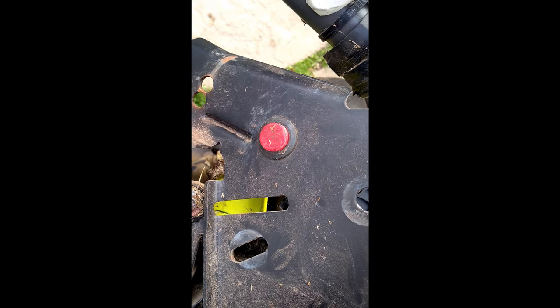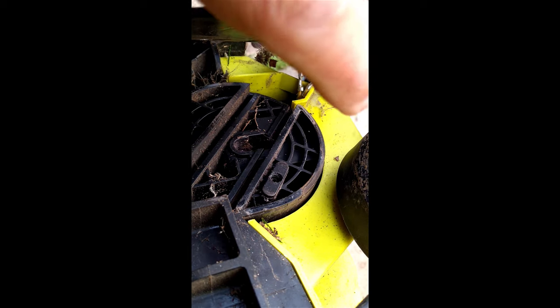When you're done with these videos, if you replace all three the way I show you, your lawnmower will work perfectly. You'll be able to turn it on and off and won't have any issues with it stalling out or dying. Let's get started. Make sure your lawnmower is in the highest position. You're going to need a T20, T30, and T40 to take out these screws and get to the switch. Underneath here you'll see the safety switch, which is the problem, and the hookup to it — we're going to disconnect that and join those two cables together.